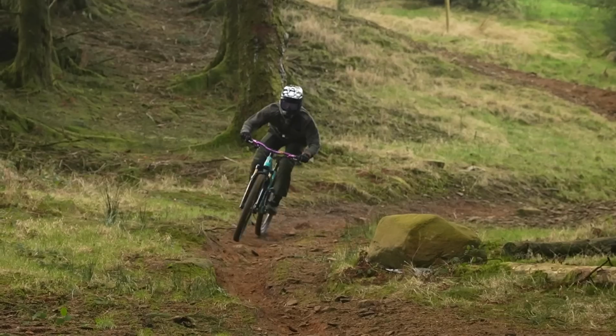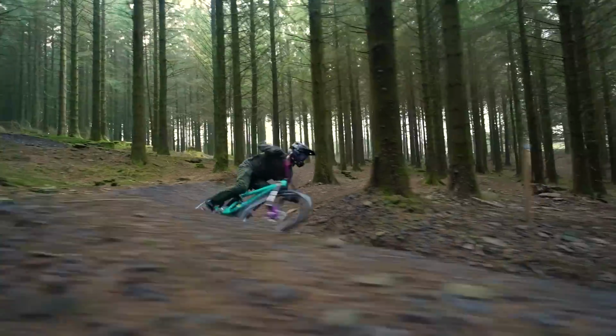I need to touch on this because when we went to Bike Park Wales, we did adjust the fork to suit the rider, but the adjuster didn't really adjust that much. And we wanted to give this bike a real fighting chance. So we spent time setting the suspension up as best we could. But as with a lot of this really entry-level suspension, a lot of those savings come from cutting back on the dampers. We've done videos in the past where we've done strip downs, and lots of the parts that you would imagine are in the fork aren't in some of these very, very low price products. But I guess the main thing is that the usable range of adjustments wasn't that huge on this fork. So that's why the fork functioned the way it did.